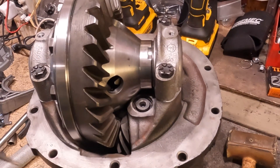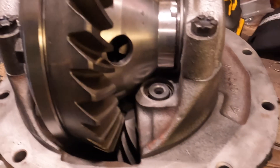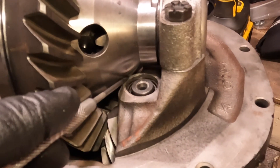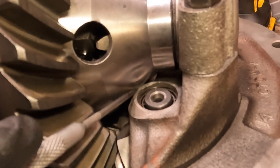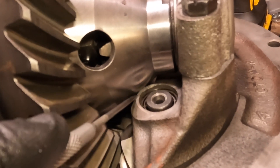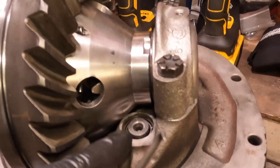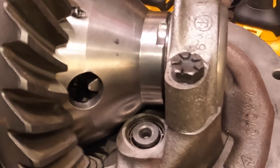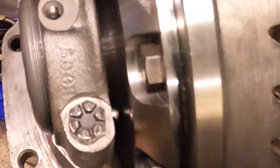I've been fiddling with this thing trying to get it together for about 20-30 minutes and finally found the problem. I'm going to take it all back apart because the housing is too big to fit right here — it's actually touching where the pinion support area is. I'm going to have to get in here and grind a little bit of this housing away just so it can fit all the way down and not be rubbing. Just one more thing about these aftermarket housings that they don't tell you — bearings and clearances.